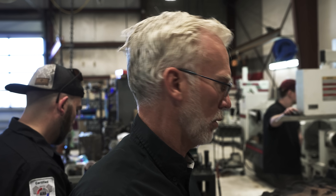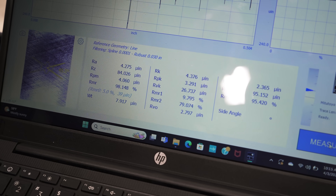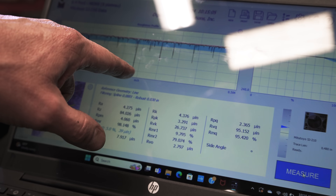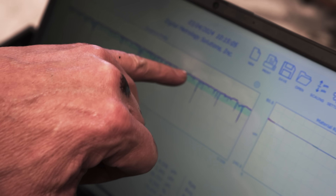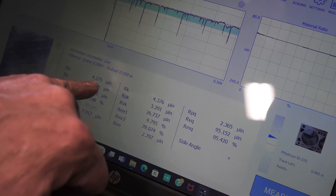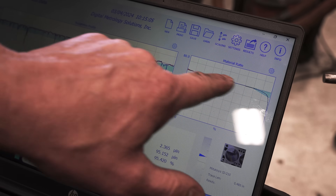We're pretty smooth. I've got decent valleys but nothing for the rings to really break in on. The cylinder wall surface — this blue area here — this is actually the surface of the material. Our RA is only 4.2. That tells us it's too smooth. You've got decent valleys but our material ratio here is terrible — we've got just a smooth surface in a valley. Now we know why that top ring had so much carbon and blow-by: too smooth of a surface. You'd be absolutely shocked at how many shops do not have this technology to actually look at the surface finish.